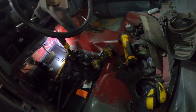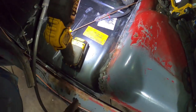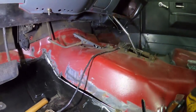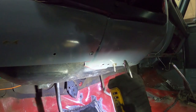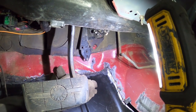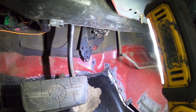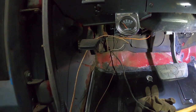I'm an idiot - I forgot to turn the camera on. So anyways, that's what she looks like - nice and smooth. There's my gap I've got to deal with like I said. Right up in the end, the problem is it's so tight in there I had to run the zip cut in sideways, so the gap is a little bigger than I wanted. So I just jammed a piece of TIG welding rod in there and gave it a couple of buzzes. But otherwise it's pretty good. I haven't attached it there obviously because it's still rusted out. Got all my little plug welds done.